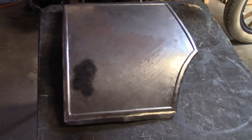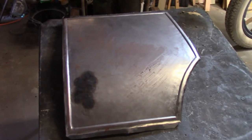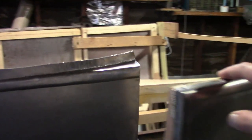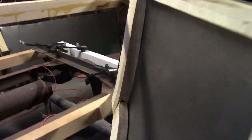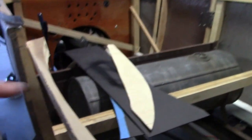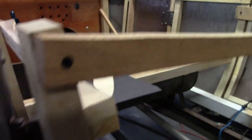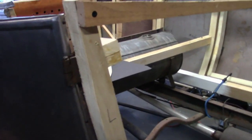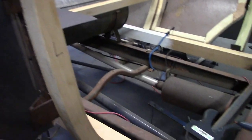Now I'm going to throw it on the car and align it. I've installed the door and am working on aligning it now, which is pretty much the same thing I did with the front door. These door posts for the rear doors are held in place by the seat frame, which I don't have, so I got these temporary braces holding it in. Once I get it set exactly where the doors line up, I'm going to leave it that way and build the seat frame around it.